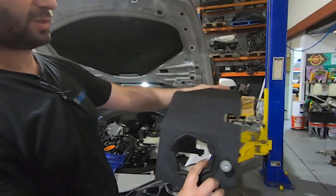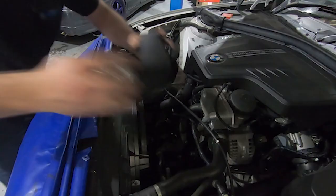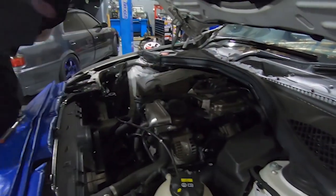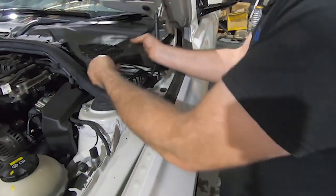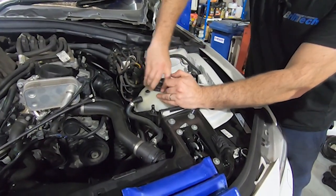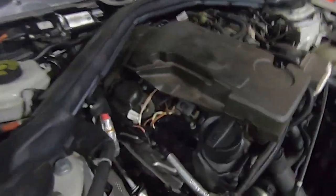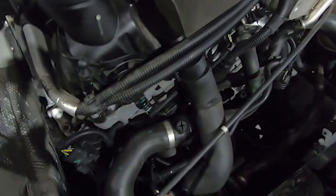Nice little air box enclosure there - very well made and planted. We've removed a few of the initial trims and exposed some coolant hoses and the fan and things that need to come out. But before we do that, I'm just going to take it up and drain the engine oil and some coolant so we can minimize the mess when we undo things up the top.